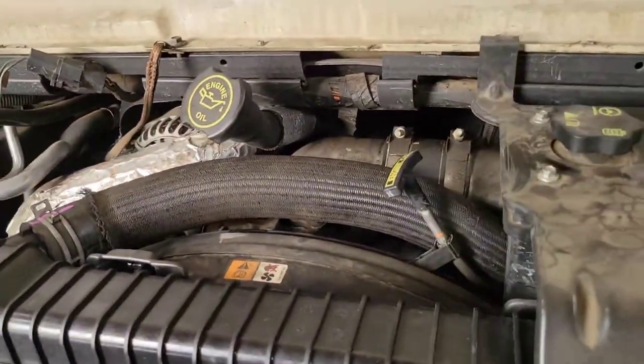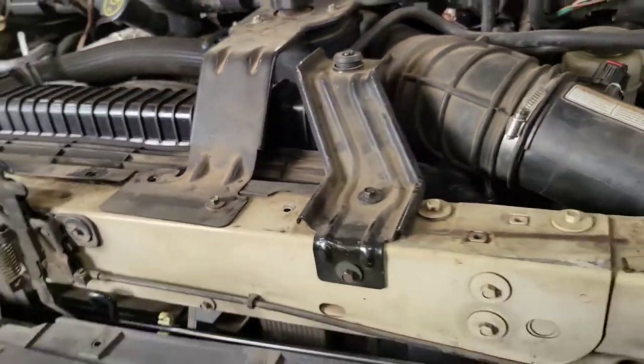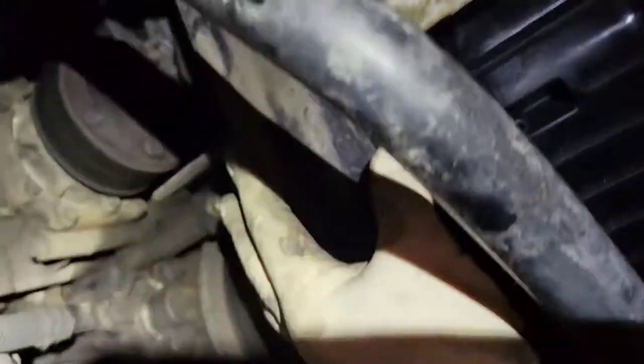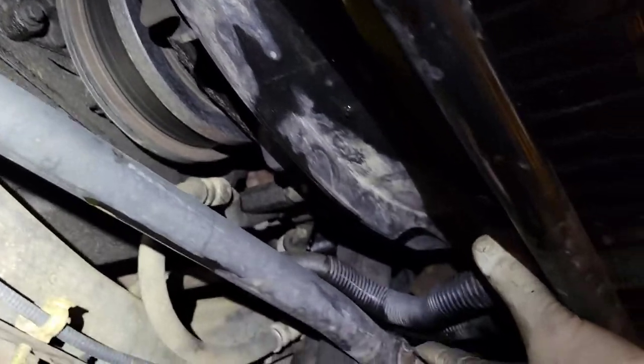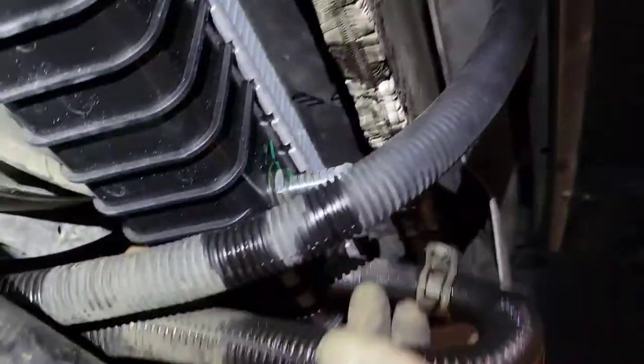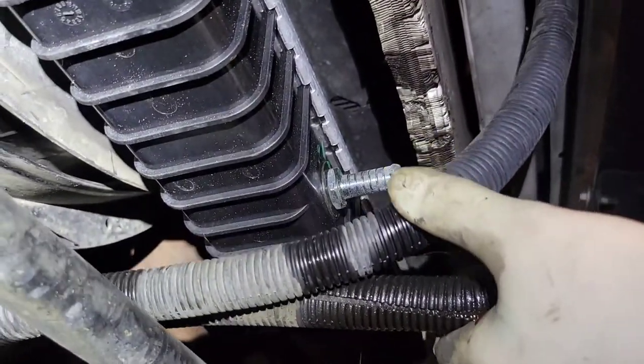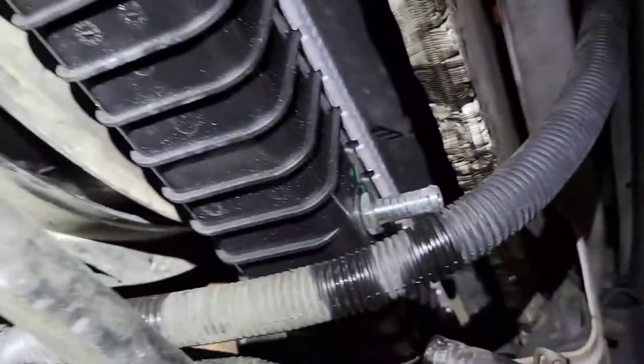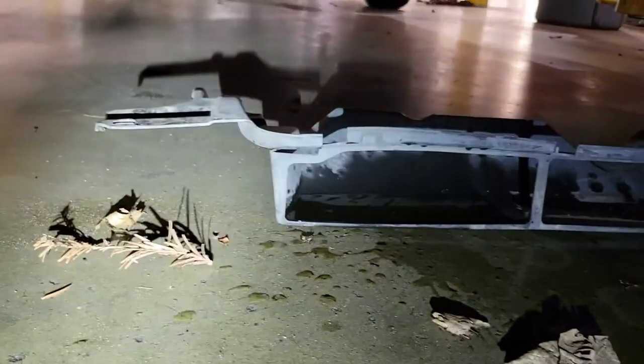Let me show you underneath. Up top it's all done — it's a pretty easy job once you figure out how to do it. You're going to have your lower fan shroud that goes across here — I haven't put that in yet. You've got two coolant hoses here that go through the bracket; you have to pull it over to get the bracket out and get the lower fan shroud off. You've got your transmission cooler hose here, another transmission cooler hose here, and the lower radiator hose which I've tucked back and runs up there.